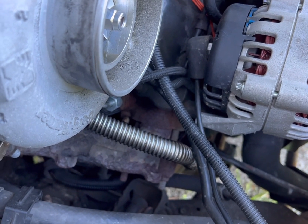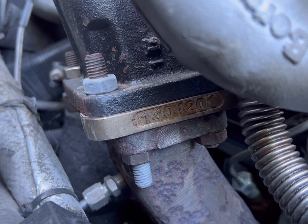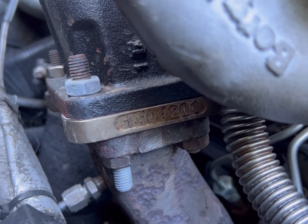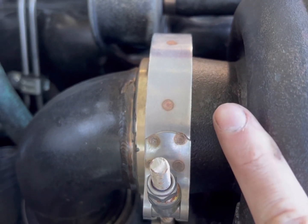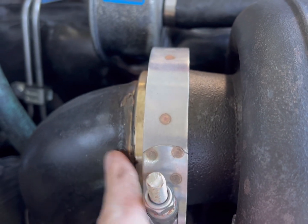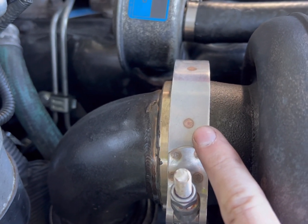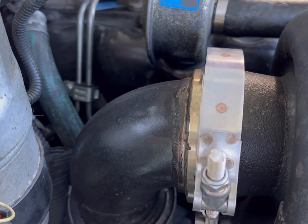You can use a stock 65 oil feed fitting in the Borg. You can use an upgraded 65 oil drain tube on these. There's a little bit of a bend down below. You can see the T3/T4 adapter from BD Diesel that we run, which allows us to hook this thing up. On the back here this is just a V-band coupler adapter flange — it goes from, I believe, three and three quarter inch to the three inch, so your V-band is stock coming size and then the outlet is your three inch for GM.